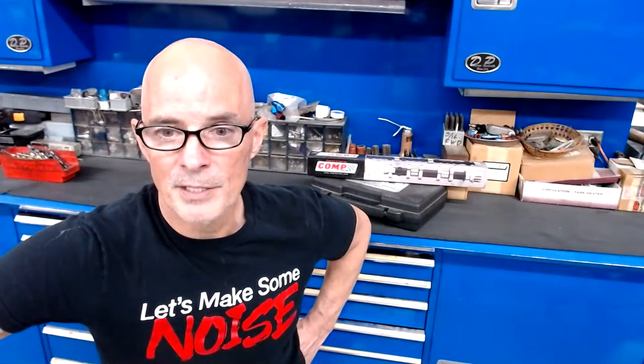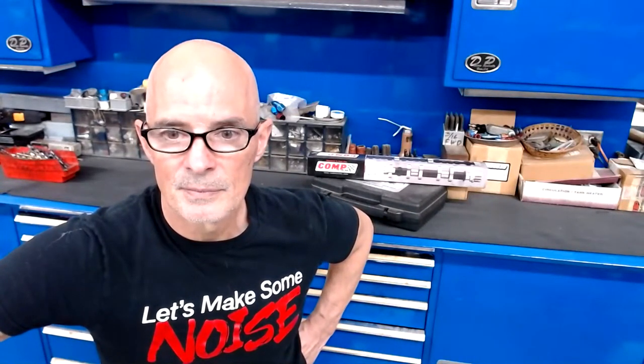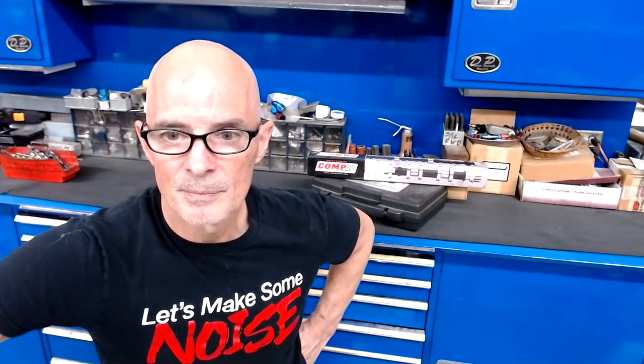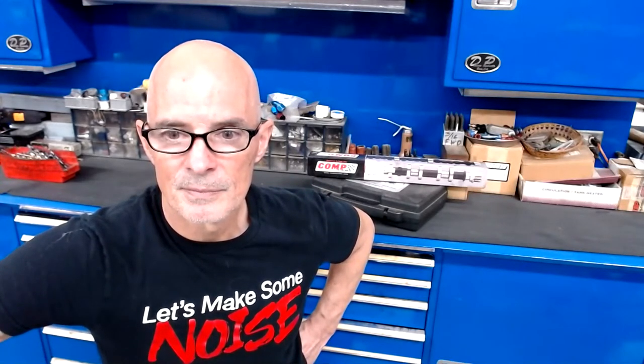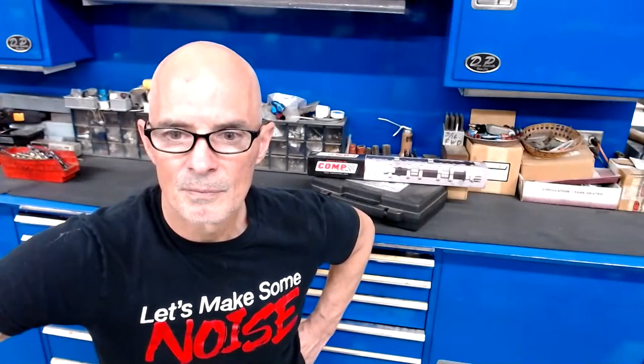Yeah, stage three on a 4.8 is a lot of camshaft. What's a safe horsepower stock 5? Well, you shouldn't be trying to boost a stock 5 liter. You should do other things to it. I mean, you can add boost to a stock one. It's just that you're starting out with so little power that the boost is not going to help that much.